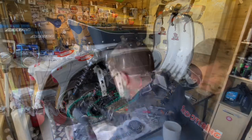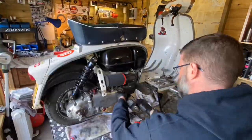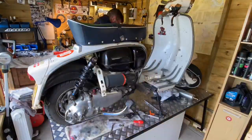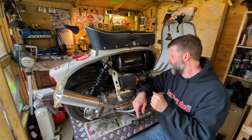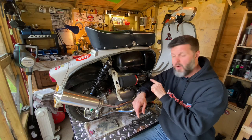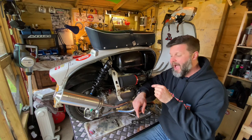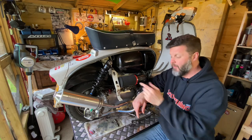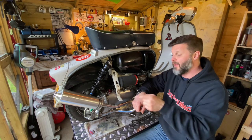Right, that's everything put back together. I just need to put some oil in the gearbox and then it would have been ready for a test ride had the other carb not started leaking. So I may as well do the carb strip video on the other side now whilst I've got this on the bench and figure out what the problem is, then once that's solved we'll get it out for a test ride. I can tell straight away, just from using the clutch compressor tool, that it needed a firmer action to put those clutch springs back together, so I'm pretty confident they've done what I need them to do. I'll get this all finished off, do the carb strip video, and then we'll get out for a test ride. Okay, see you on the next video.